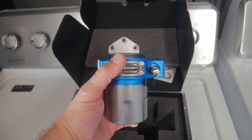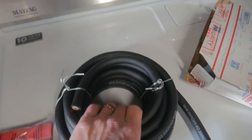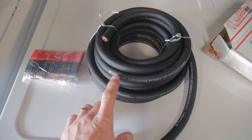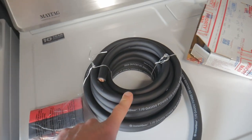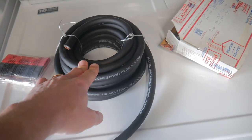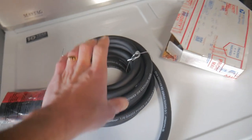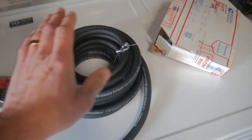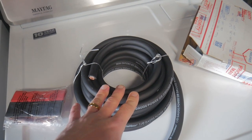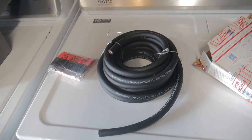I need to figure out how to mount that and put it in line on the fuel feed. Over here I have some zero-gauge wire to make a new battery ground. This is from Install Gear — probably a third purchase I've made from them. I'll leave the link in the description for this wire and these terminal connectors. It's incredibly affordable for the length of wire. Install Gear seems focused on audio equipment and car accessory installation, but this should do really well for a ground to the engine block.